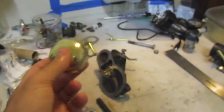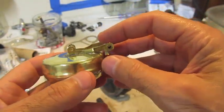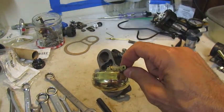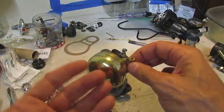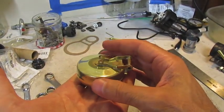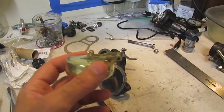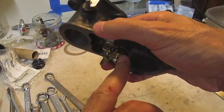To test if the float leaks: first, you can just shake it — if you don't hear any liquid inside, that's good. Another way is to boil water on the stovetop, secure the float down with a string or weight, and let it sit underwater in hot water for about half a minute. If you don't see any air bubbles coming through the water, it's probably okay. The hot air inside expands — if there's a leak, you'll see tiny bubbles come out.